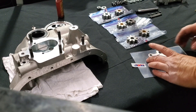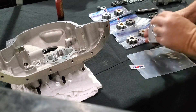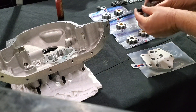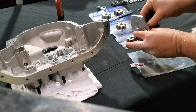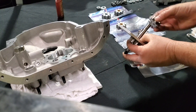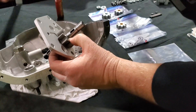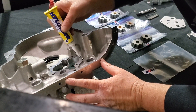We've got to build our inner pump, flip this over, and we've got our floater plate — that's why I like to WPC treat those. We've got our main drive shaft, get our keyways in here, get our middle driven gear, bring that up through carefully, and then on the back side one more keyway. I've got all this lined up previously as it's important. Here's our inside and you can see the sandwich on the floater plate — that will drop down in. I like to put just a little bit of Hylomar around the floater plate seal.